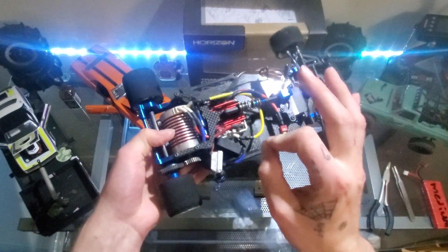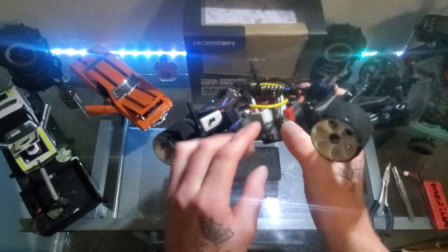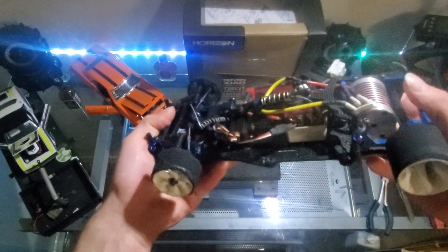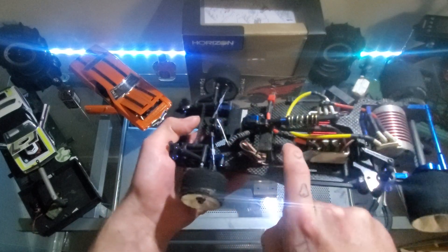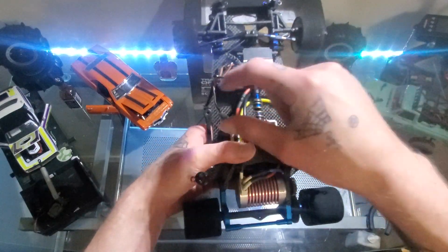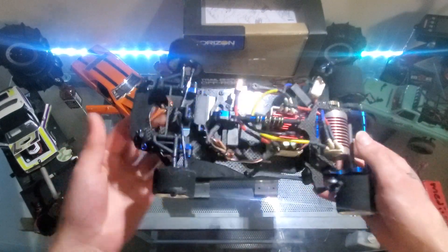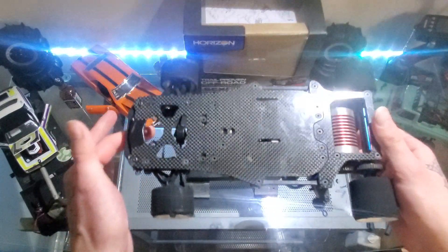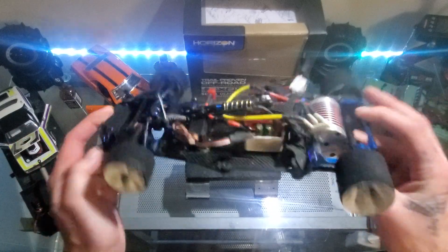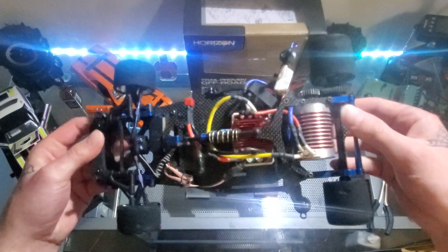I redid the switch and moved it right here so I can just reach under the body — nice and simple, no digging around for it. I also moved the receiver right here, the cords come into the front and go right into it, and there's my antenna which also helps keep the battery in the tray. I'm still having trouble getting the battery to stay — it flies out once in a while. A lot of the stuff for these cars is kind of secretive; nobody wants to share their secrets, especially for gear ratios and what they call rollout. But I figured out my own rollout and it's pretty solid.